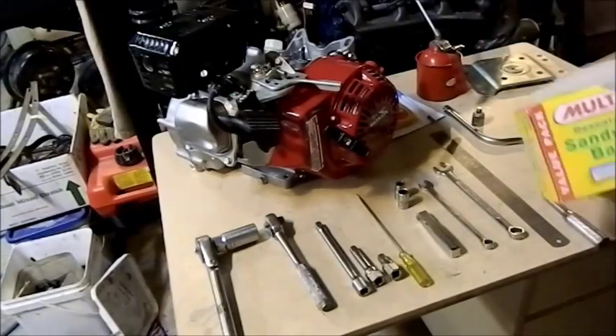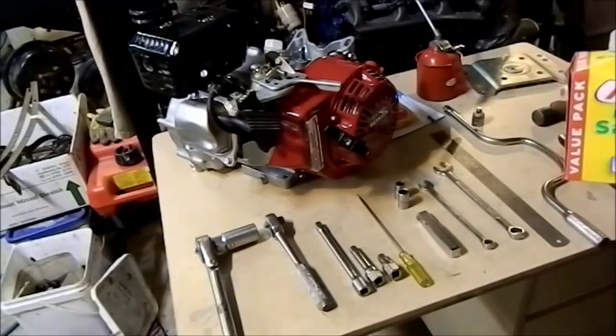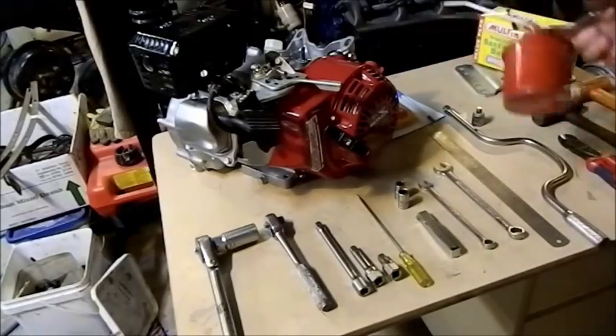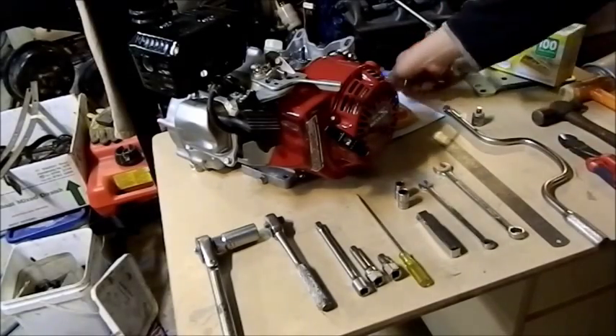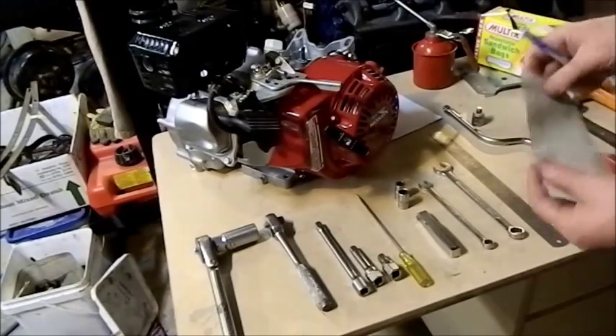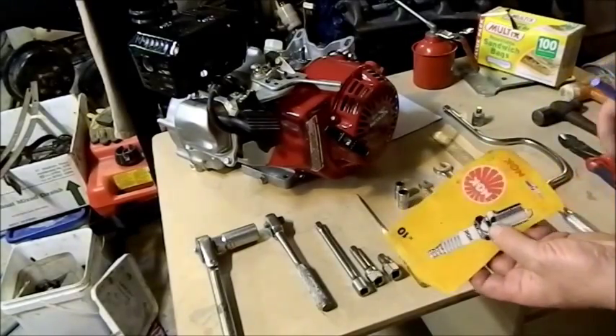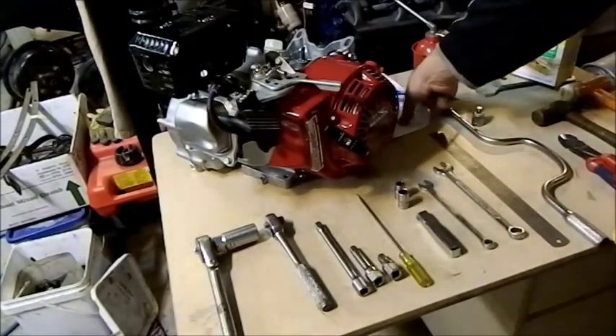You also need this large piece of steel with a washer to knock the clutch out. Of course, you don't do anything without sandwich bags — bag and tag is the most important thing of all. We'll also use an oil can when putting parts back, and a piece of thin cardboard — like a cereal box — which is great for setting up the gap on your coil to get a nice healthy spark.